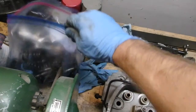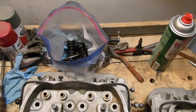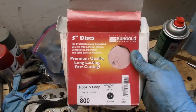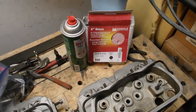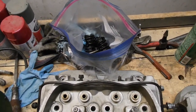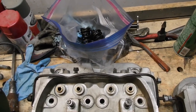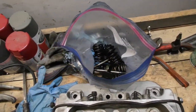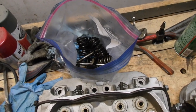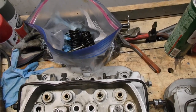Now I'm just going to go after the valves and springs and give them a little bit of a clean. What I'm going to use is some 800-grit 5-inch sanding discs that I am never going to use. I will use those because they will remove basically nothing. If you look at the episode I did on rebuilding and merging the 034 and the 009 distributors, using a bit of 400 or even 800 grit can take off microscopic amounts, but not too terribly much, and it will just kind of get them smooth and clean.